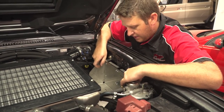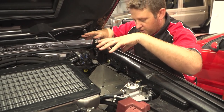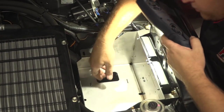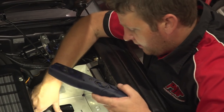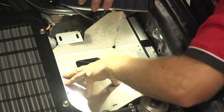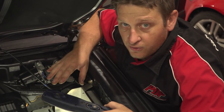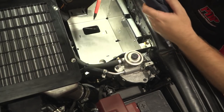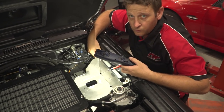The tray will actually go up and down - the reason for that is so we can move it up and down, as the guard to the inner guard can always be slightly different from car to car. The weight of the battery is in the tray, so we want the legs of the tray to be on the inner guard - that's why it's slotted. Leave them loose, put your hand in there, have a look at the wiring, and make sure you're happy where everything's sitting. The next step is to mark and drill the holes through the guard - that's going to be the sitting position of the tray. Once you're happy, mark the four locations, pop the tray out, drill the holes, and then do the final installation.